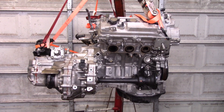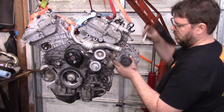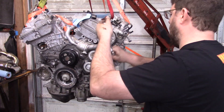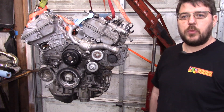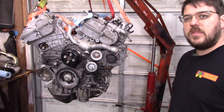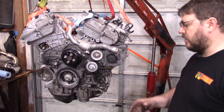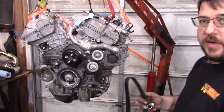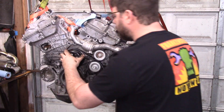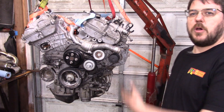If you haven't done it yet, you should clean the outside of the stubs — it'll be a lot easier to do now than when you're underneath the car. Now we've got our stubs in. Now would be a good time to mount the alternator. Something to mention about the alternator: there are several people who complain that it squeaks when idling. This alternator is supposed to have a one-way clutch in it, and you'll want to check it — a lot of these, by the time they've sat in a junkyard for a while, are actually seized. For this build, to keep things simple, we're not putting air conditioning on, so the belt we need is a six-rib. This is a seven-rib motor — you're driving a water pump and an alternator, there's no need for seven ribs. Nothing special about the routing; since there are missing ribs, make sure you leave the missing rib at the same spot everywhere. I just put the belt all the way back and that works for me.